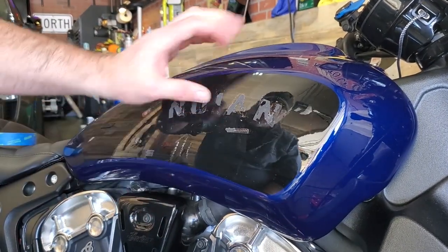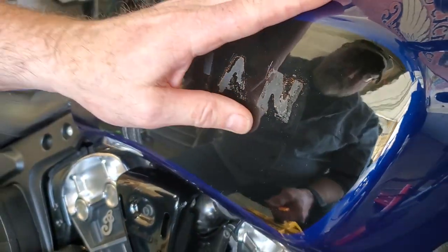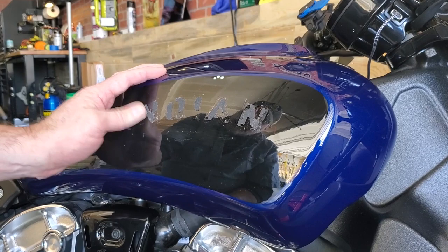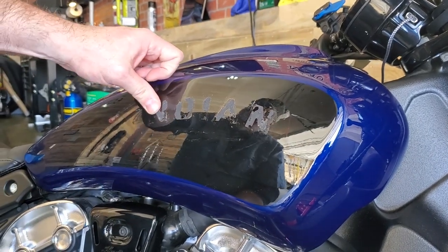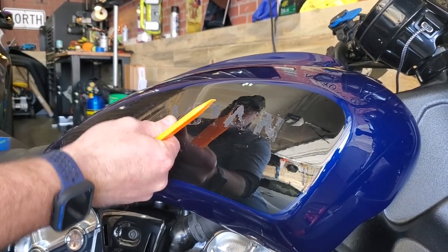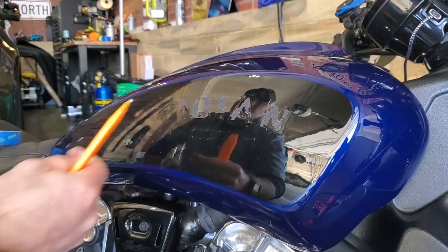There's little tiny abrasion surface scratches like swirl marks — it's hard to see because there's so many smudges. I'm going to be covering most of those, but I'm afraid of some of the outer edge ones showing. So when we get all the adhesive off, I'm going to hit it with a finishing polish and a polishing pad on my random orbit polisher just to make it shiny. Not something you could do on a matte finish, unfortunately.